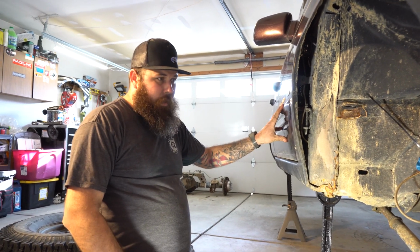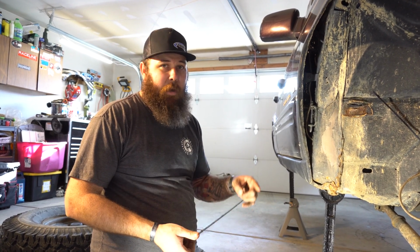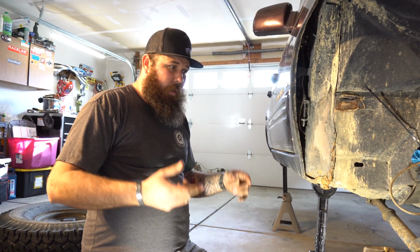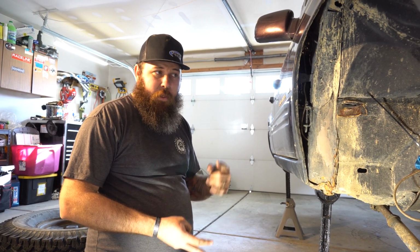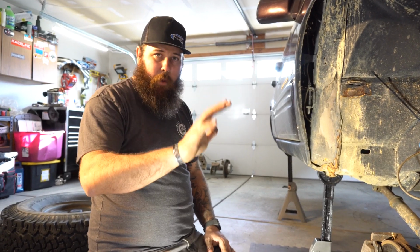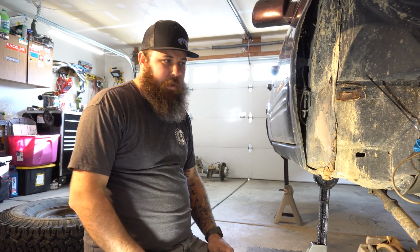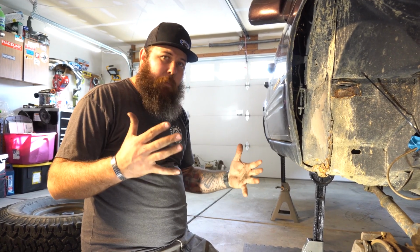And these Jeeps come with 2 axles from the factory. A Dana 35, which is absolute garbage. Don't buy it, throw it in the trash, don't waste any money on it. They break. I actually might even see if we can put a photo in there of one that I broke on 33s without a locker, on just a slight bump. You know, we were off-road and went to kind of go forward and fell back down, and it just exploded. Broken axle shaft in the spider gears and all sorts of stuff. So the 8.8 is a much stronger option.